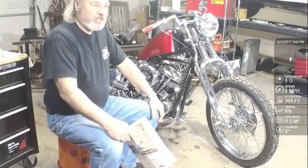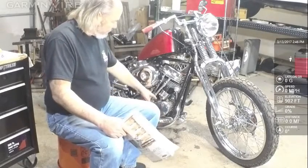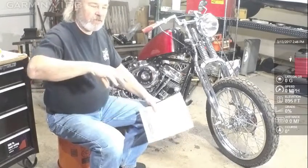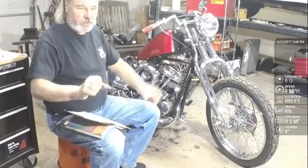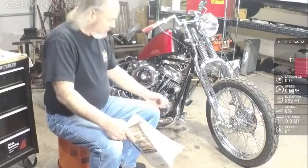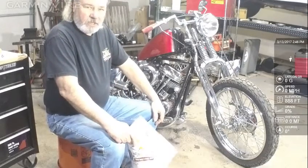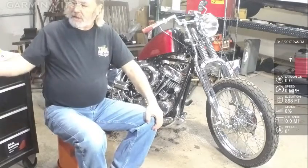but around 1970-ish, you got an improvement in that they came with an automatic mechanical advance, which meant you got rid of the manual advance that was on the handlebars. And shortly after that, they came out with a cone engine, maybe it was that year, which had the points in it still, but it was a fully automatic advance.